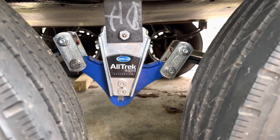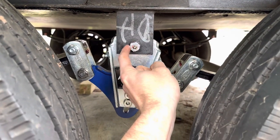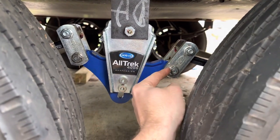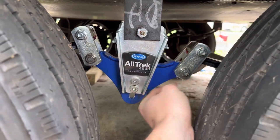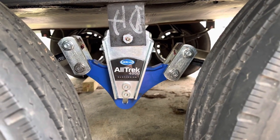Tip number two: get yourself a half inch impact. And on the opposite side, all the bolts look like this — this is the back of the bolt. Go forward and back after you loosen your front nuts. After you loosen the nuts, go forward and backward on the main bolt in the back, or whichever side it is, to kind of loosen those teeth up from inside the shackle.